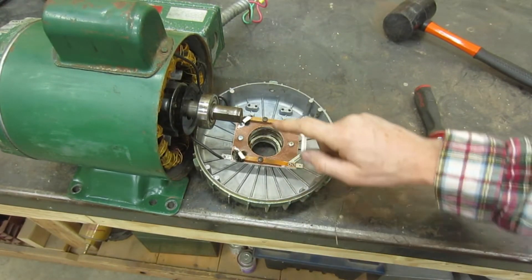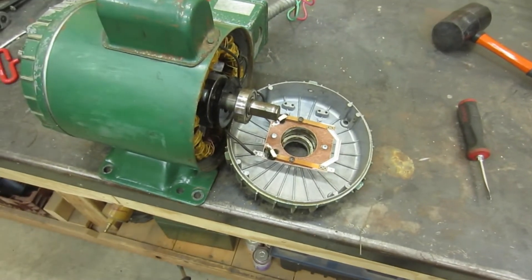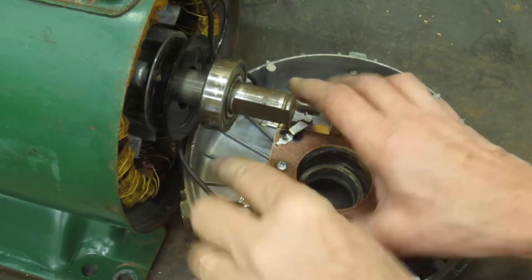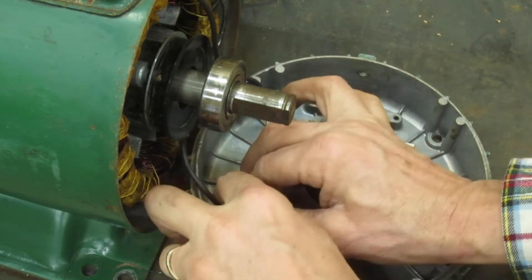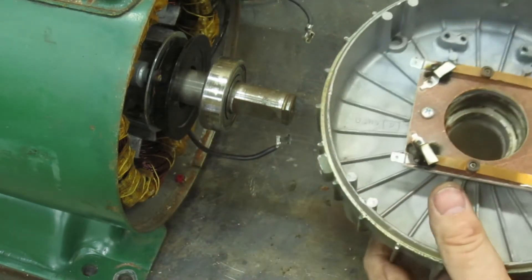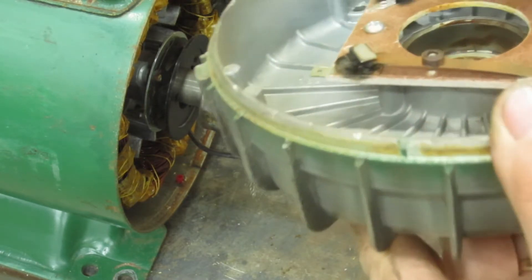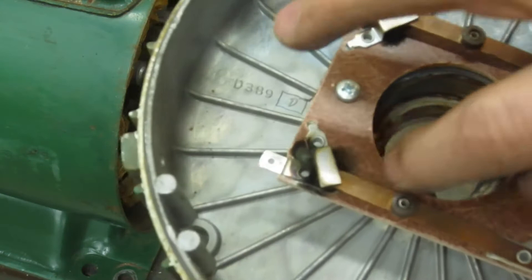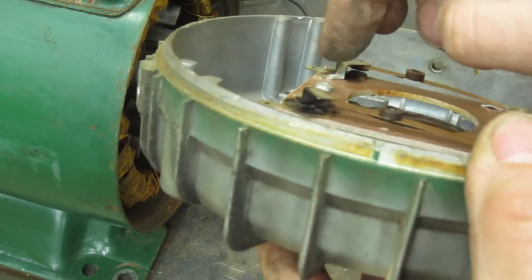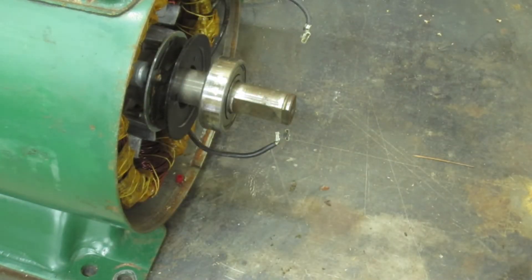With the back cover off, you can see we've got a couple of wire connectors here. All we have to do is pull these off gently. One of the things I'm going to do before I reassemble is clean up these contacts — you can see a lot of grit and burning around those contacts. Getting a little emery cloth in there and cleaning those up can only help. We'll set that aside.